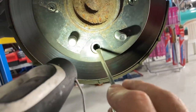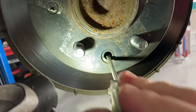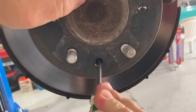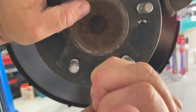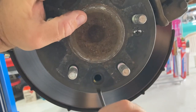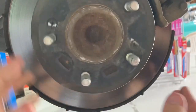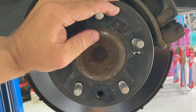If we just turn it one way it'll click around — that's what will adjust up the brake shoes inside. And that's locked the rotor tight. Then if I just back it off a little bit, the rotor can spin again. So just click them up all the way until it locks the rotor.